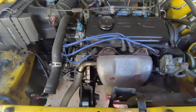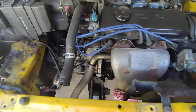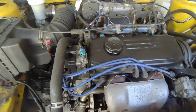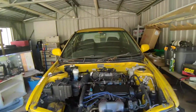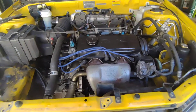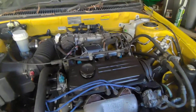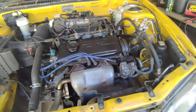All I'm going to do is lower the engine - that's going to hopefully just drop straight out the bottom. I've got a little removalist dolly - slide it in under there, lower the engine onto it, then jack the whole car sky high and just slide it out the front. I think it will be a far easier way to do this than trying to maneuver that thing up and out the bonnet, because these are an absolute pain to do that way.